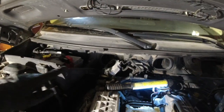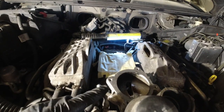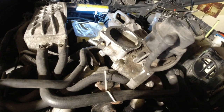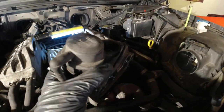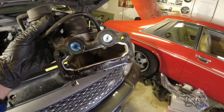It's just sitting over there. You can just bend it over to the side. So that bolts to here. When that is bolted on, you get access to four Torx screws here, which are pretty much impossible to get to. Then there are some vacuum lines and the sensor to disconnect. And this is the back of the supercharger. So that's where the air comes in.